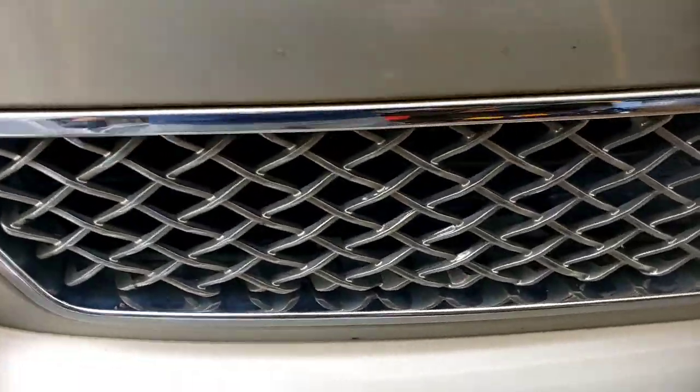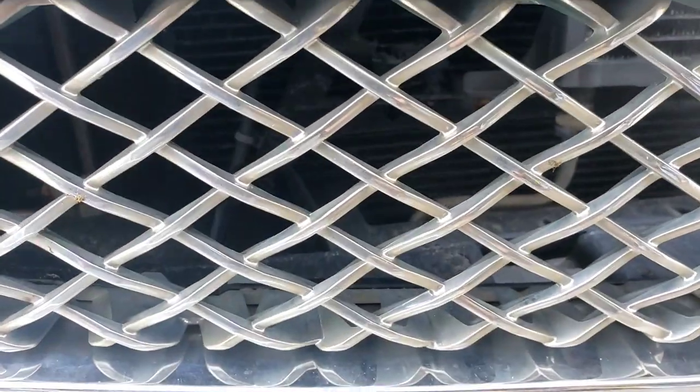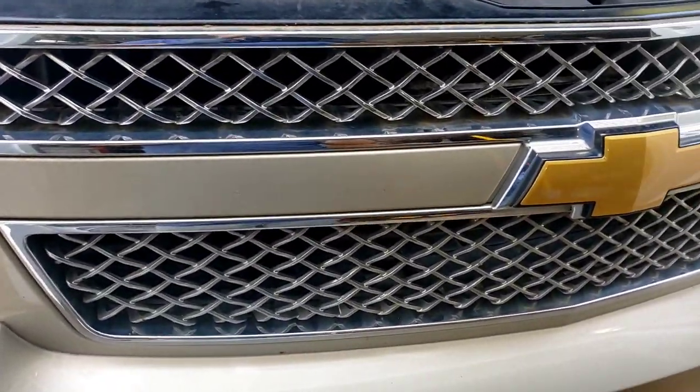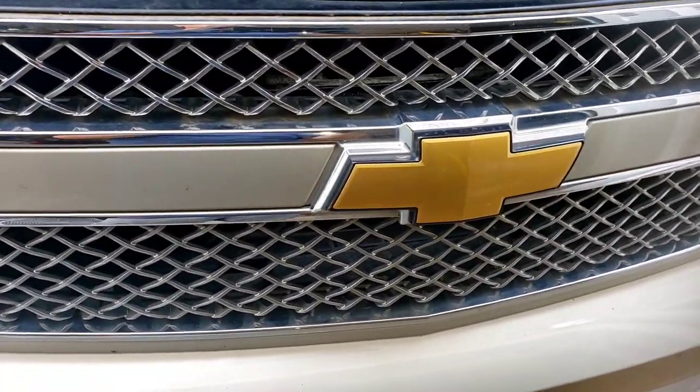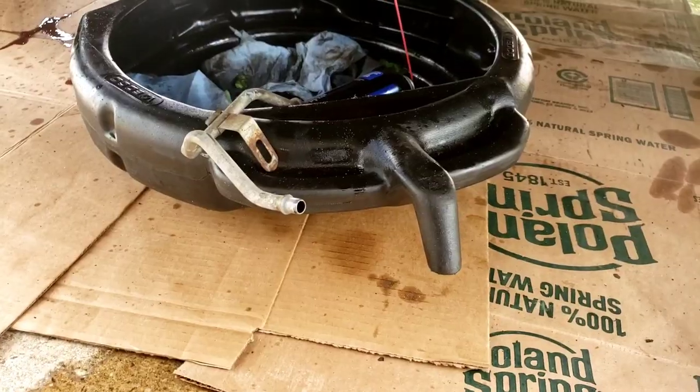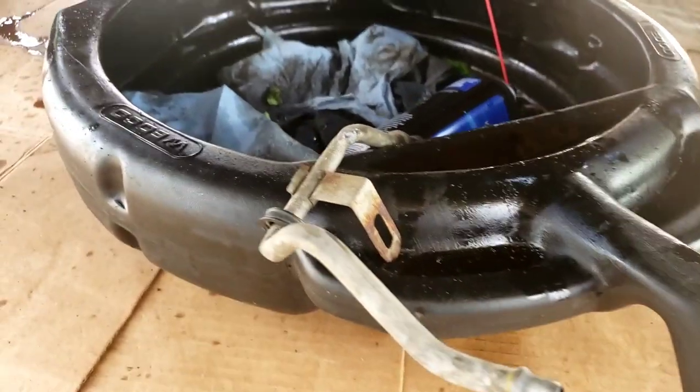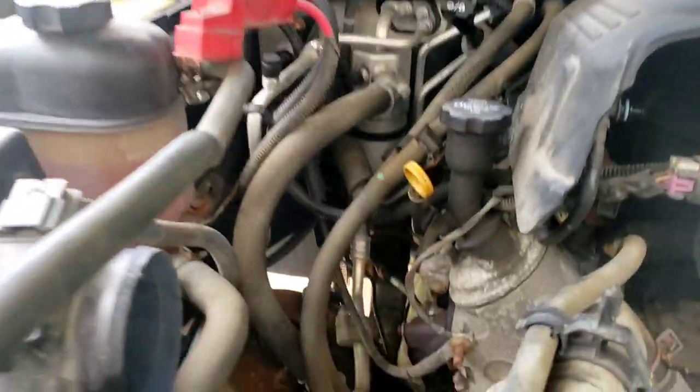Now I'm going to figure out the other one — the one that's behind the grill. Pretty nice, I can take the grill out, don't have to take the bumper out, but we'll see. Some grills are part of the bumper, so that's just the way it is. Don't forget that little clamp — there's a clamp on the original one, it's spot welded on. The replacement one comes with a clamp, a new bolt and washers, but I like using the original hardware.